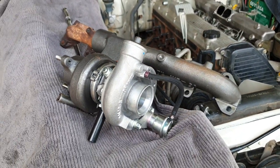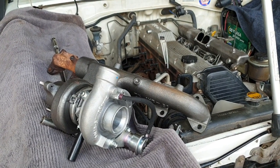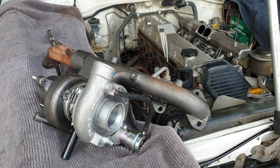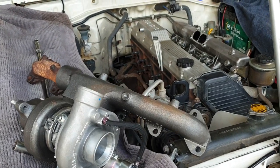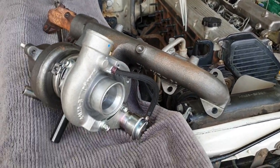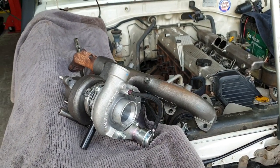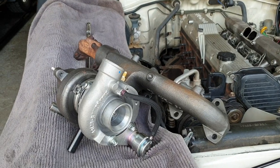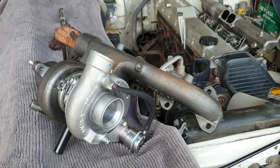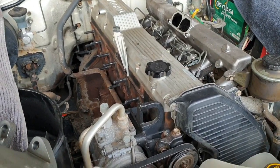So when you put a turbocharger on and set it up properly, you fix that problem — you get lots of air to a diesel, run it lean and clean and cool. You'll increase your power and torque about 40%, which is more than sufficient for a non-turbo engine that wasn't designed for turboing, and it'll last forever if you do that. But go 60, 80, 100, 150% like we see with these massive kilowatt gains — remember these things are only putting out 55 or 60 kilowatts at the wheel — we get them in regularly with problems at 130 kilowatts. No wonder: that's 100% and more power gain. You just want to go up about 40% in power and torque.